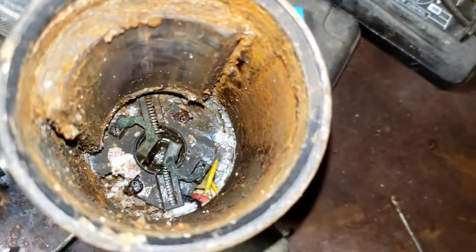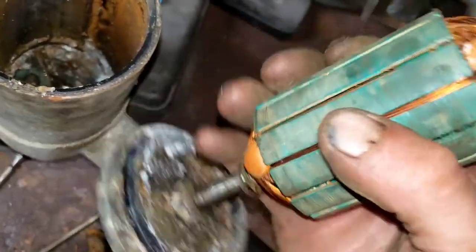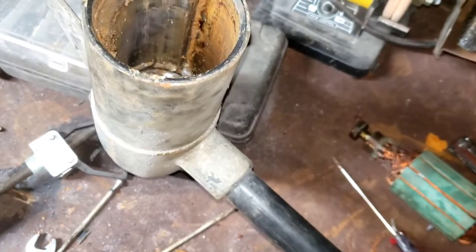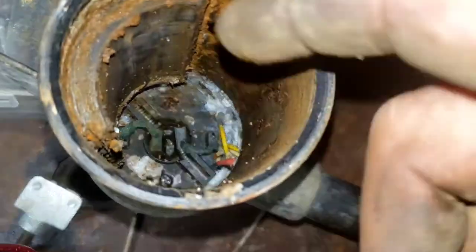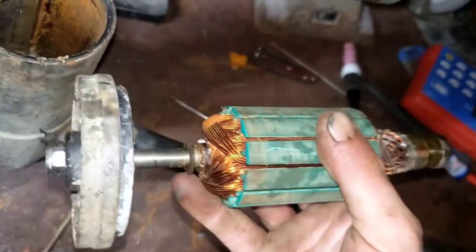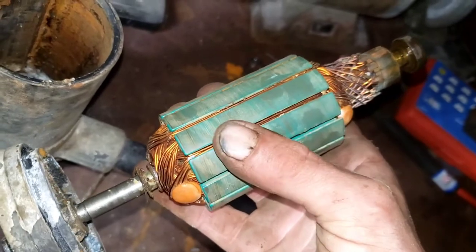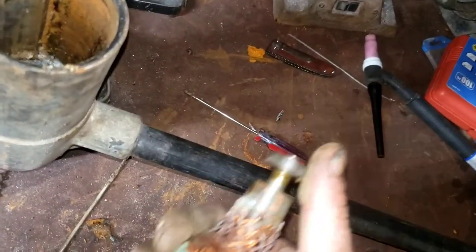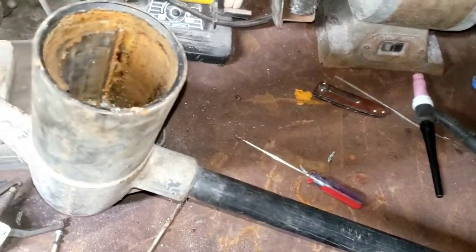In this case you don't create a spark — you just create a connection between the commutator ring and the brush, and that will put current to the rotor of your motor and make it spin. Your field is created by your permanent magnets. So that's how you diagnose your trolling motor. You're going to want to check the brushes, make sure the magnets are not broken loose, and make sure all your windings on your rotor look good and are not shorted out. Check for any visual evidence of the rotor banging up against the side of the motor, which would indicate your bearings are really shot.